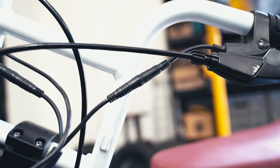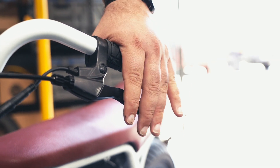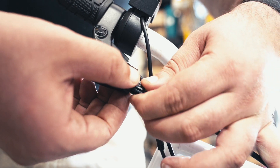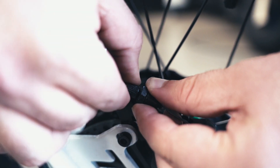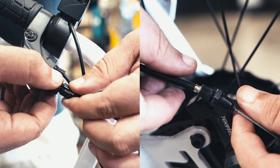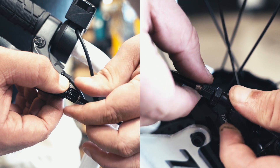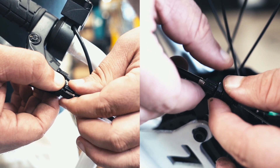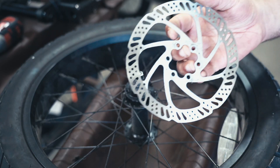For mechanical brake systems, you may need to adjust the cable tension as your pads wear down or when you replace brake pads. Once you start to notice the lever is getting a little loose, you can go to the barrel adjusters on the lever housing and the caliper lever arm to tighten the connection. Remember to reset the barrel adjusters back to the lowest tension setting when you replace brake pads, and then adjust the cable tension at the pinch bolt during pad replacements as necessary.